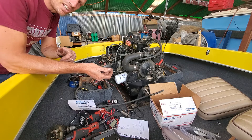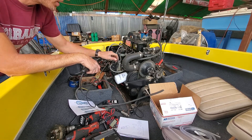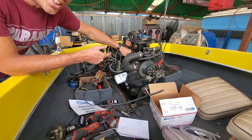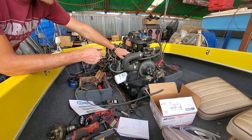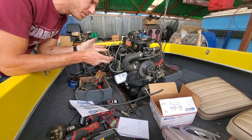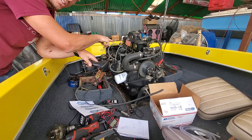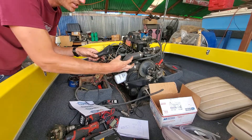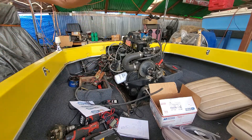What we're trying to do is find the compression stroke. I'm going to put the camera on the mount and demonstrate. I have my remote starter hooked up and I'm able to rotate the engine. I've got the spark plug out and I'm clear of any plug wires that might shock me. Stick your finger in the plug hole and keep going — it'll suck, then do a little of nothing, then it's going to blow a lot of air. That big pulse — that's the compression stroke. This is a bit of a gorilla way of doing it because it's hard to stop exactly where you want, but it's doable. You can pinch the V-belts or put a big screwdriver through the pulley bolts and use that as leverage — there's just no nut on these inlines to put a socket on.